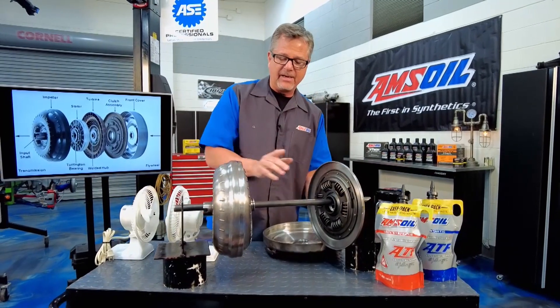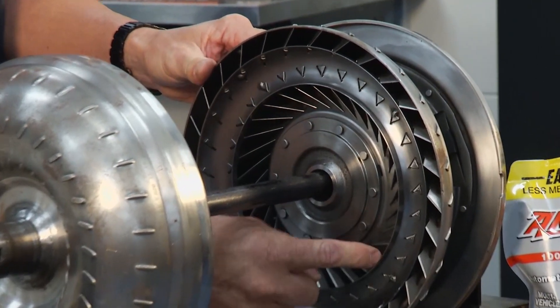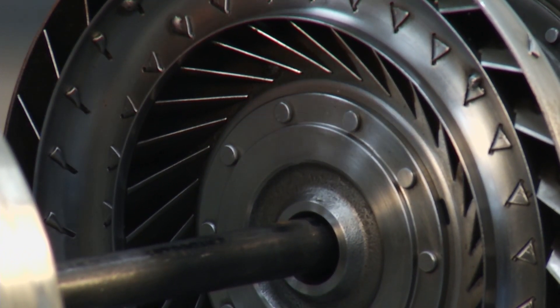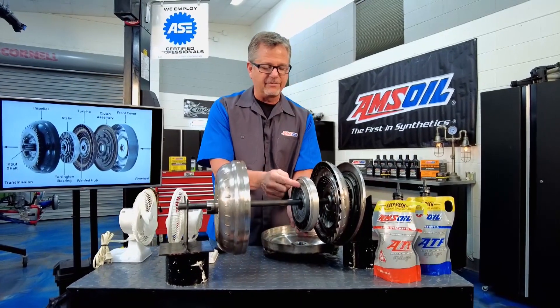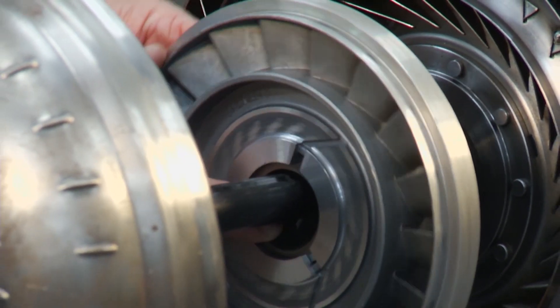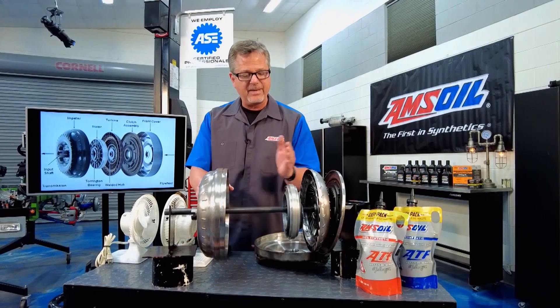The first piece right here is the turbine. If you look inside the turbine, you have these fins — these fins either rotate the fluid in a vortex or it goes through rotary flow, and that's going to multiply torque. It's going to hit this stator, and the stator then redirects the fluid. This is a one-way clutch — it locks up in one direction and it freewheels in the other, directing the fluid over to the impeller and back around we go, from the stator to the impeller.